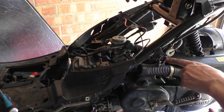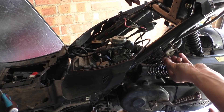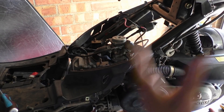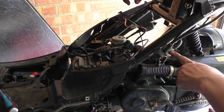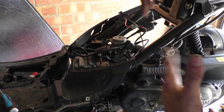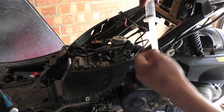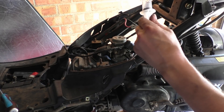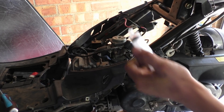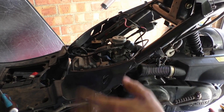So how this whole thing works: when you take this off, nothing comes out — and that's good if you want to replace your tank or get at your carb. The residual stuff in your carb will still leak out obviously. But the way this works is inside here there is a diaphragm, and a diaphragm is basically a flexible membrane — think of it like a drum skin, or in a sense like a plunger, a rubber seal. But the difference with a diaphragm is it works on differentiating pressure: is there more pressure on one side or less pressure on one side than the other — a pressure differential, like a lot of things in engines.